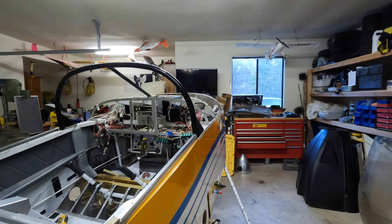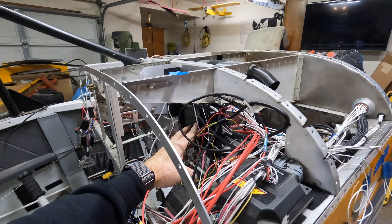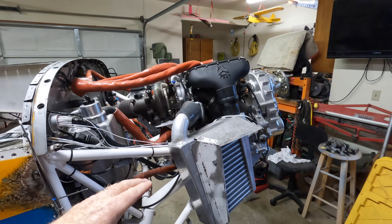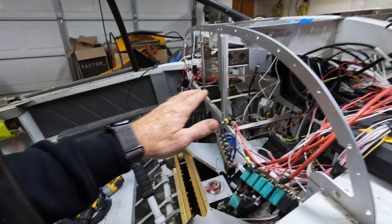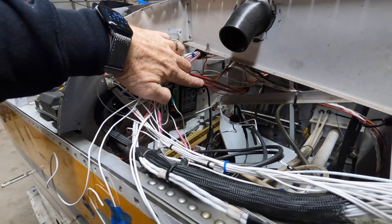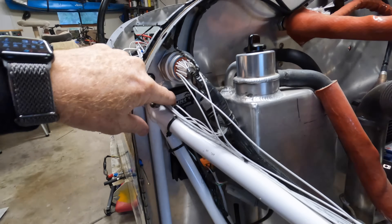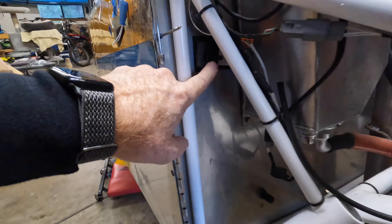On the other side you can see the wiring — I've just been going through it, kind of labeling what everything is. Over here you've got your Hypersports Link ECU, an AM 22-channel CAN bus for sensors that takes sensor data from everywhere: gearbox temperature, water temperature, oil pressure — all kinds of sensors all over this engine to monitor things. Down into the fuse section there are a couple additional units for engine monitoring, another 12-channel CAN input, a couple other boxes for the Link, the CAN lambda sensor, and I think an atmospheric sensor that comes with the engine.